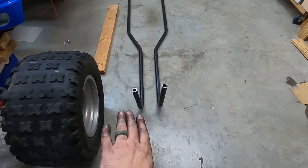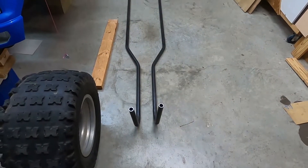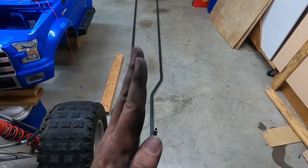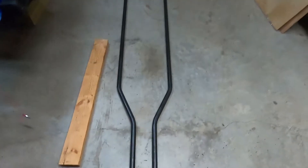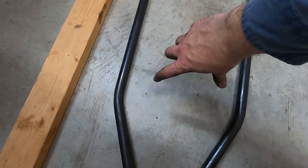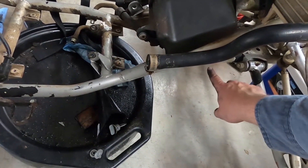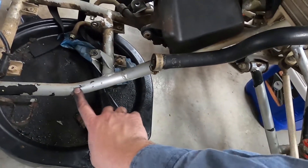That actually went much faster the second time. And there's what I got. I know the left one looks like it's bent out, but there's a crack in the floor and it's making it want to walk. But it's actually really close to being a perfect 90. This is the same distance as this right here, and this is an inch and a half over. But that's to be expected because I don't know what these exact bends are. I just did the trig and found my triangle. I knew what this angle should be and that's what I bent everything to. It came out to some weird fraction of 23 degrees, so I bent everything at 24. And you're just going to have that error.